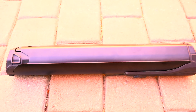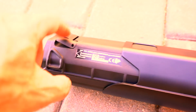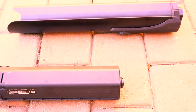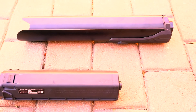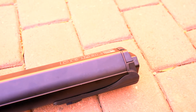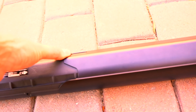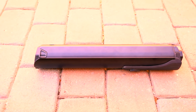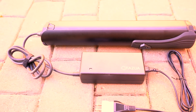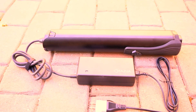Here's a look at the drive pack removed from the bike. You can also remove the battery — just push this down and it slides out. The 36 volt, 7 amp hour, 252 watt hour battery takes up a little bit more than half the space in the drive pack, and then you've got that 250 watt motor right there. To reinstall, slide it back into the drive pack and it clicks into place — overall just a very clean system. The charger plugs into the battery at the top of the drive pack and takes about three and a half hours to fully charge from empty.